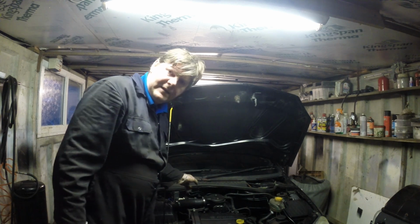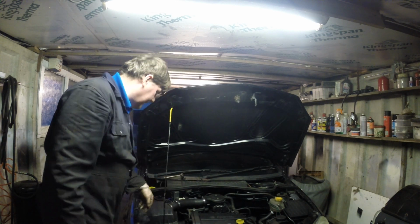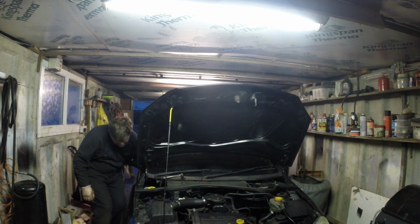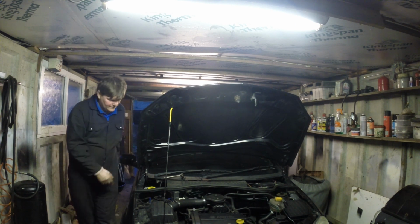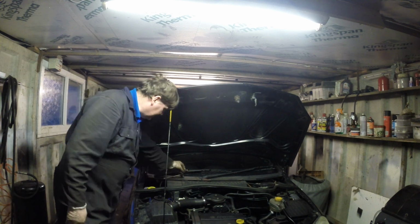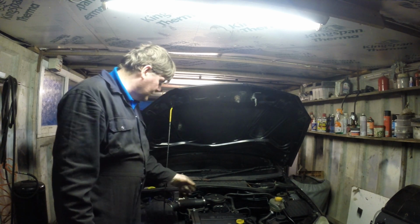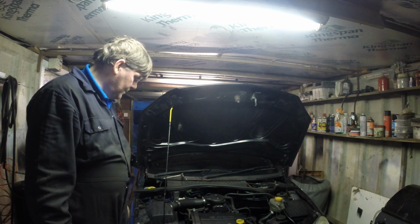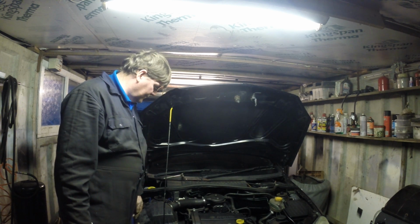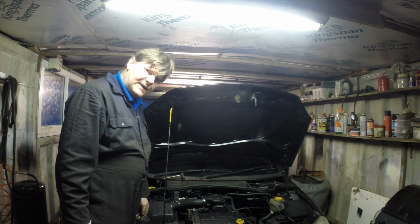Okay, now I said I'd put back in what we think is the faulty camshaft sensor. It's back in, and we'll see if it'll start. Go. So that was what was stopping the engine from running. So we've managed to prove that. Got a few other issues. The cooling system seems to be a problem there. I don't know whether it'll need a flush, but I don't know whether the coolant's circulating or not. But we'll leave that for another time.